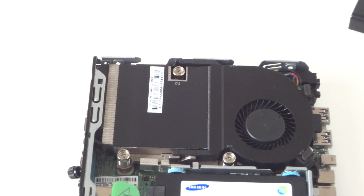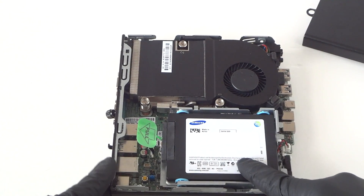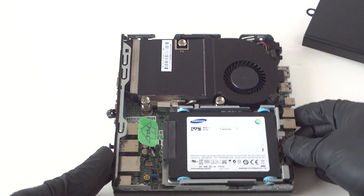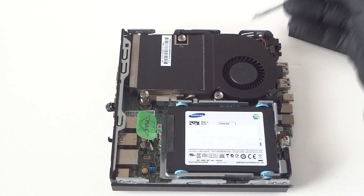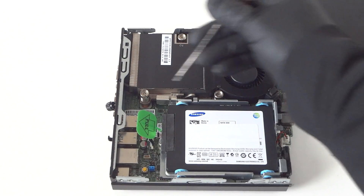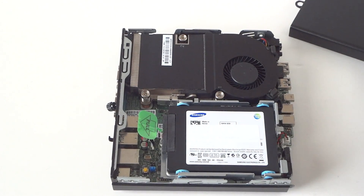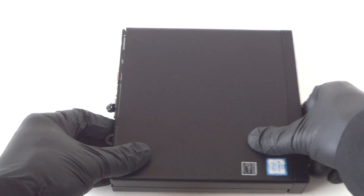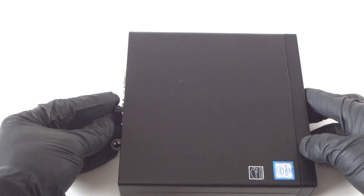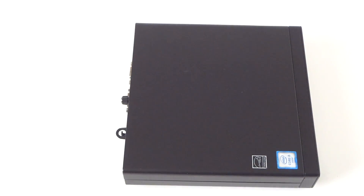Let me zoom out the camera so you guys can see better. Put the side cover panel back on. So guys, we upgraded to a different solid state drive and upgraded the memory to a total of 8 gigs. To upgrade the processor it's really easy — all you do is remove the three screws, one, two, three, and it comes right out. The heat sink comes out and there's the little processor right there. So that's it, guys — we upgraded the memory and upgraded to a solid state drive. Thanks for watching, bye!